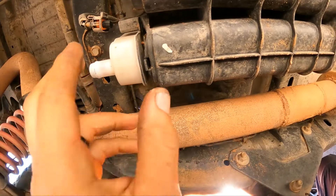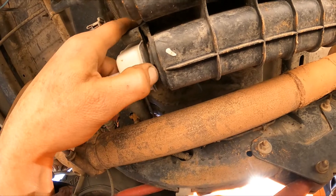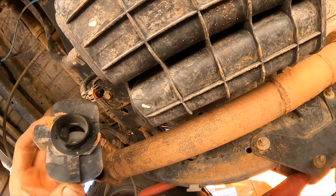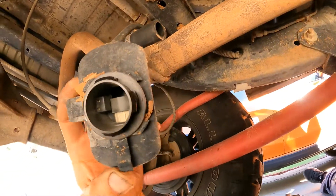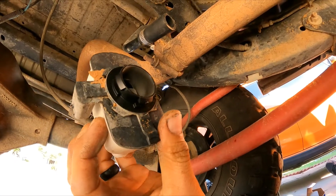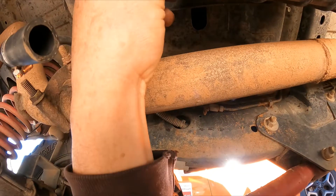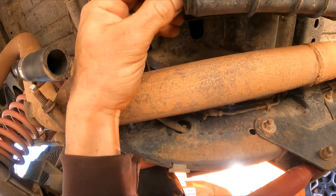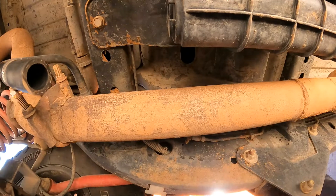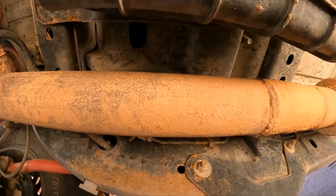The first thing we're going to do is disconnect this hose — it's a nice and tight fit. Then you lift the tab here, pull it right, and twist. The part comes off. As you can see, sometimes that valve right there stops sealing and that could be the problem. But the leak was coming right through here, between those two areas — so we are going to replace the O-ring and the leak detection pump.